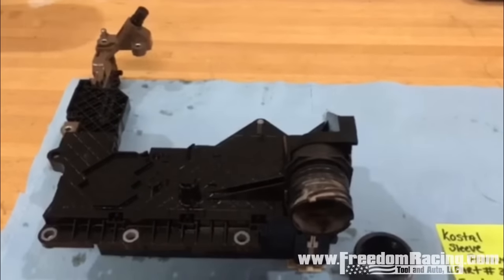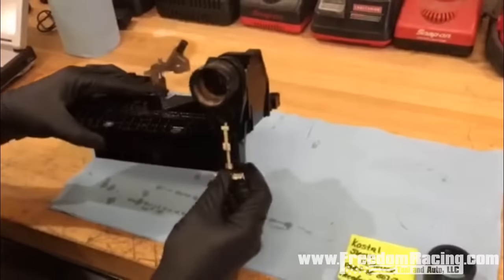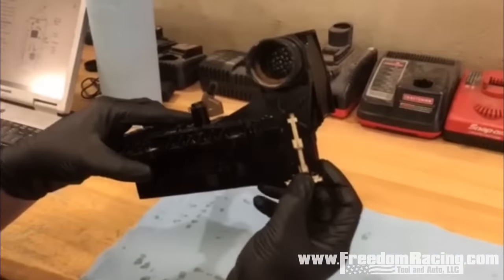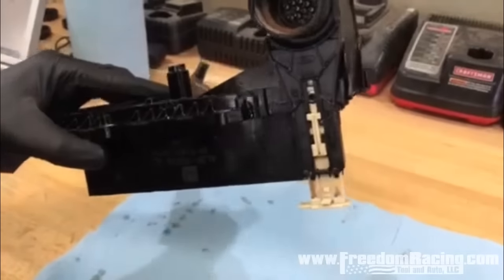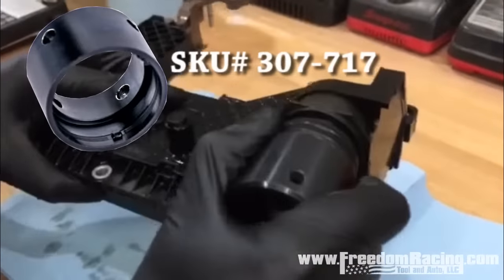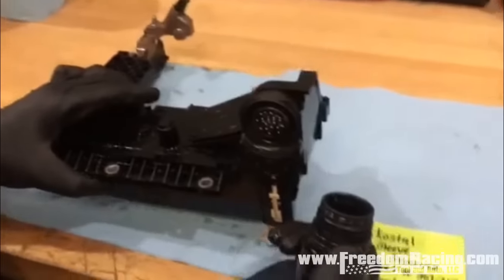We have the old one up here on the bench and we're going to show you guys how it works. We got the molded lead frame here and we need to get that out so we can pull it out of the transmission. The first step is you're going to pop this connector here down — just got the little retaining clip there, you can push that in and then pull it down and it pops out. Then you can take your tool — it's got little tabs to hook in where the bulkhead connector goes — and just twist it on there and then wiggle it.